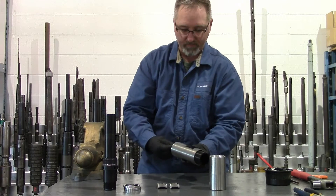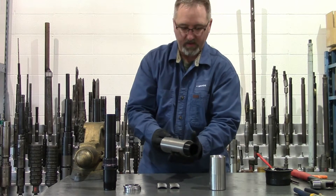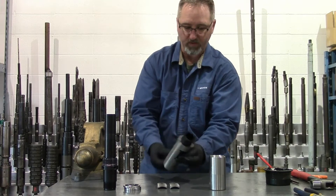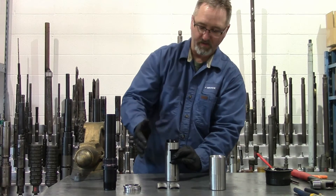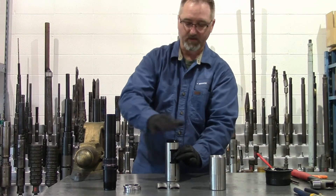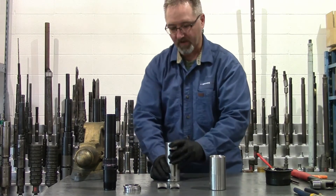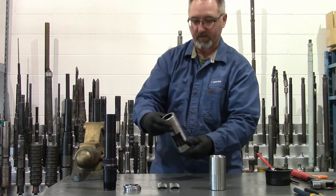Same with the other side. I just hold tension on it with my forefinger and my thumb and make sure my holes are aligned. Then with my other hand, put pressure onto your expander sleeve and push it into the window housing of the key retainer. It'll be in there and those will be held in place now.